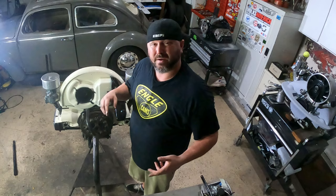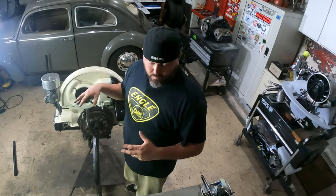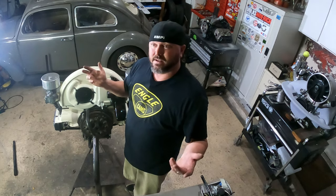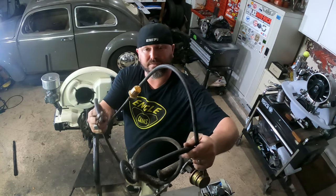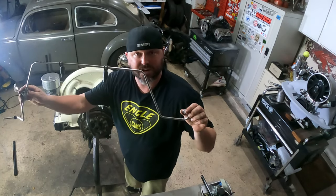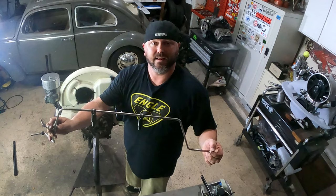That's the front side of the motor — carbs on, distributor on, linkage on, everything hooked up. Super clean, super nice. For hooking up the carbs, because this is a later Mexican fuel injection block, the fuel pump area is blocked off — they use an electric fuel pump. So I went ahead and replaced all that old rubber fuel line mess with the Caddyshack stainless steel hardline kit for the carbs.